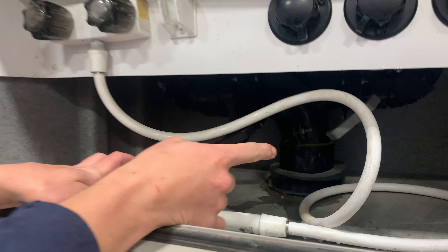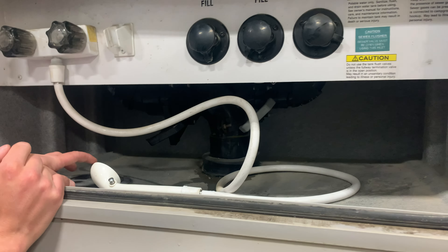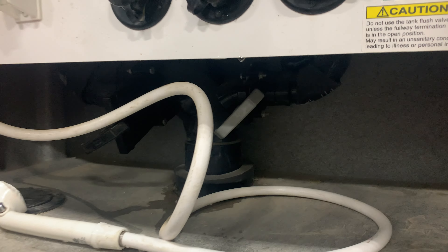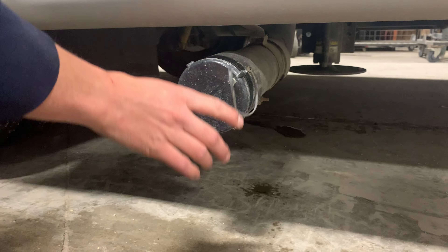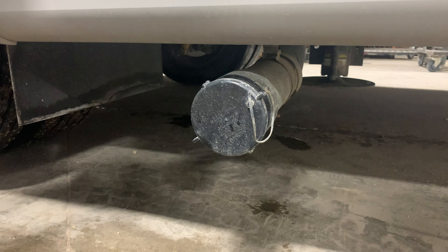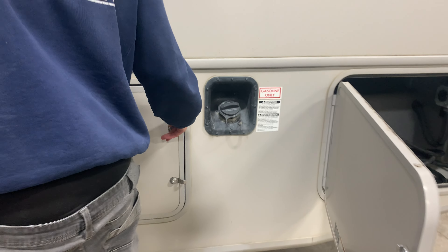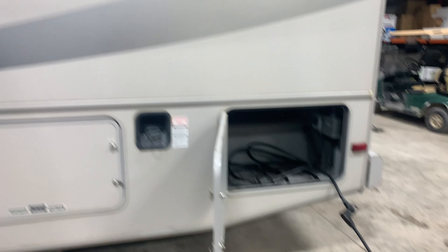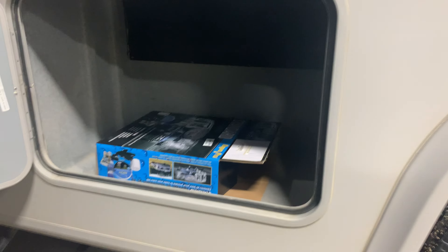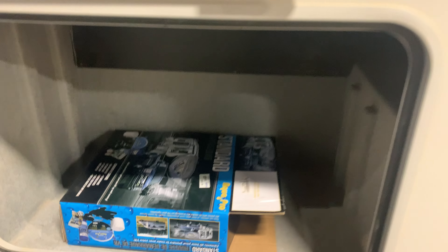You've got your black valve and your gray valve. You're always going to want to empty your black valve first — it's going to be your dirtiest water, filled from your toilets. Then you can come behind that with your gray valve, which is typically a little cleaner water filled from your sinks and showers. The outlet is just right here — you're just going to twist that off and thread your sewer hose on. Inside this compartment you do have your starter kit, which includes a 50-amp park adapter, a water hose, as well as a sewer hose.